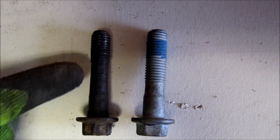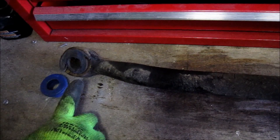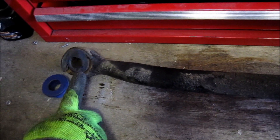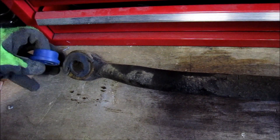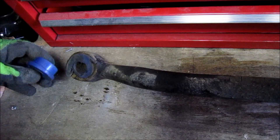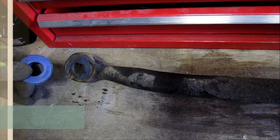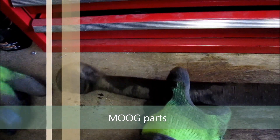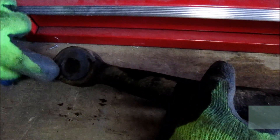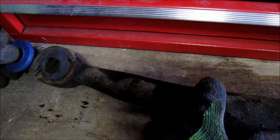This is the impact to the center of the bolt wearing it out. Here we have the old bushings still in the track arm with a lot of wear, and on one side the new bushings. The new bushing kit was about $20 at an auto parts store — these are Moog bushings, I found them to be the best. The old bushings are flattened with excessive wear; here's what they used to look like brand new.